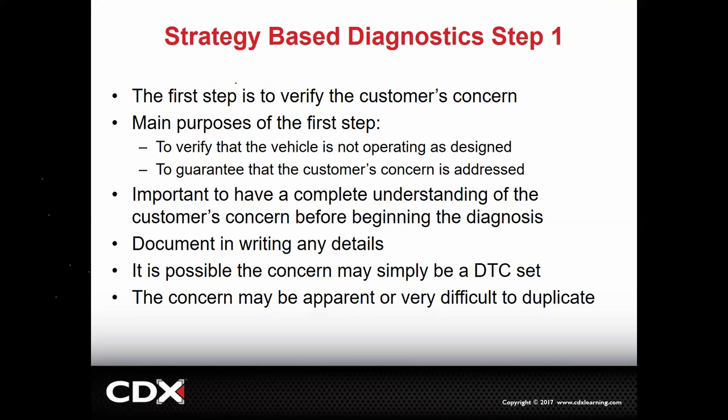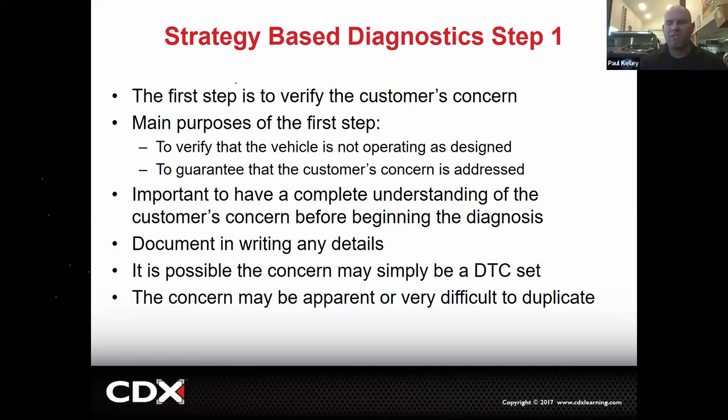Say concern is unverified, have the customer drive the car to show you their braking issue and not yours, because they drive different than you drive, right? So we really want to verify, is there something there? Is there not? What a lot of people have done, especially back in my day when Lemon Law was just getting started, they would just say, oh, a customer doesn't like their brakes, sell them a brake job. And they'd put new brakes on it, and then the customer comes back and says, same thing. So what Brandon said is right. We need to really verify this, and it may be normal.